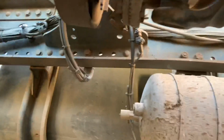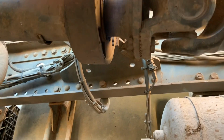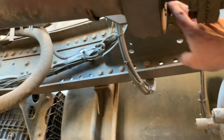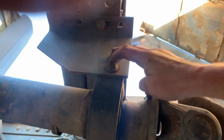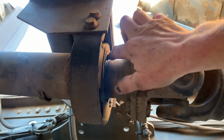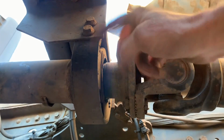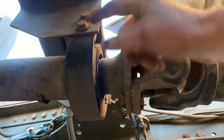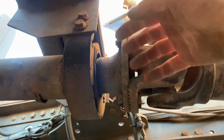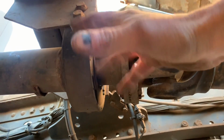and then once you get that flange off, we'll remove these bolts here, two bolts there, two bolts yon side, we'll remove them, and then I should think the bearing race will be seized on this, so if it is seized on it, just nip through it with your grinder and remove the bearing casing, and then we can clean up where the bearing sits with some emery paper, clean that up, slide the new one on, job's a good one.